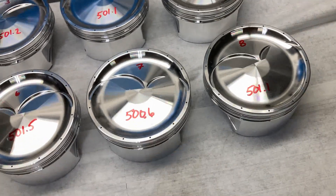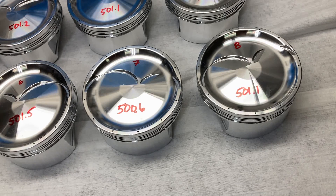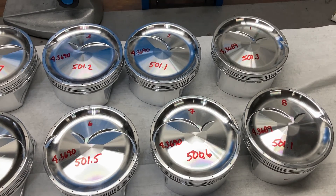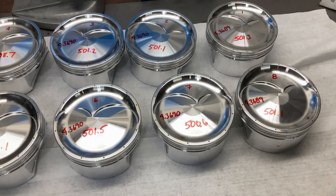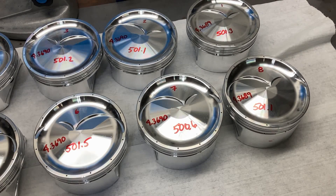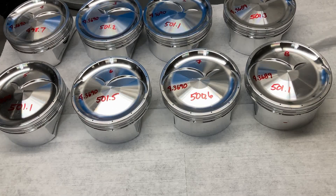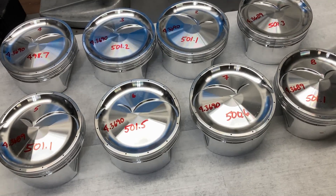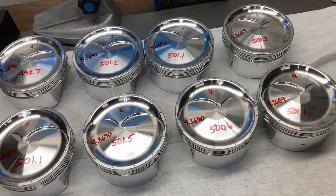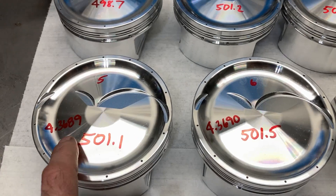Using a 6.800-inch rod with these, the compression height is 1.225 inches — so it's a pretty small piston. We got all our pistons measured up and there's basically one ten-thousandth of an inch variation between all eight. I get a lot of guys ordering custom pistons where the machinists are adamant about getting the pistons in before doing the block work — that is old-school thinking and it's not necessary. Years and decades ago pistons would vary by a thousandth of an inch, so you'd have to fit the cylinders to the pistons — but now they do not.